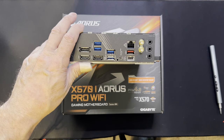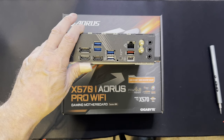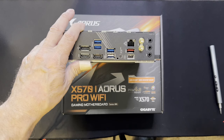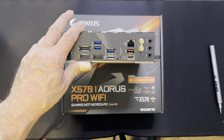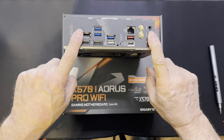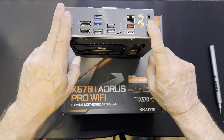It's very easy — go to the Gigabyte website support page, find your latest BIOS version, download the zip folder, create a folder on the desktop, unzip it there, and pull out the flash file. The file name is typically gigabyte.rom or gigabyte.bin in all caps or lowercase — something you have to read up on. The board comes with two HDMI outputs and one DisplayPort. I've used mine with the G-chip integrated graphics and all outputs work — I didn't see much difference in video performance between them.